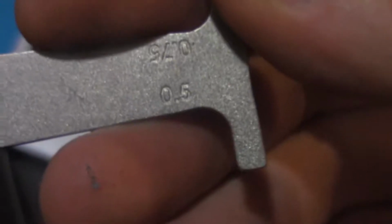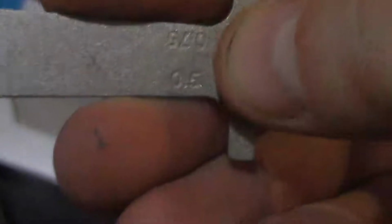We're replacing the chain, and I gotta say, just replacing these cheap chain rings and replacing your chain when it gets to 0.5 on the scale there, right there, that's the one. Once you get past that, you're going to start wearing these guys out.